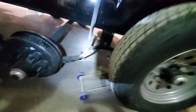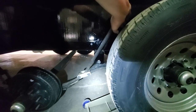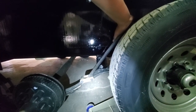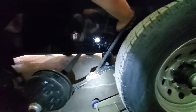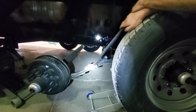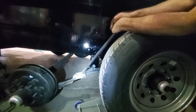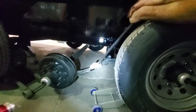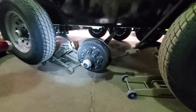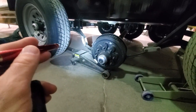We're going to take a pry bar and try to get this thing to move around a bit. The spring is trying to flip up and over. Keep that pry on and maybe lower that jack a bit. Be careful when dealing with springs and suspension on vehicles — this pry bar can turn into a weapon really fast and the vehicle isn't going to warn you when it's going to strike. Watch your pinch points and make sure it doesn't smack you in the face. Now take that jack and slide it up under that leaf spring, back towards the end of the spring at the eyelet.